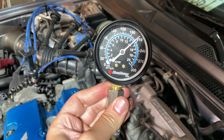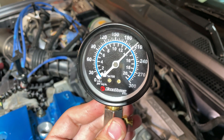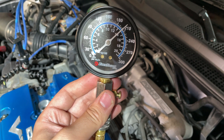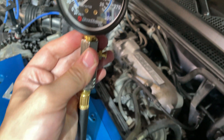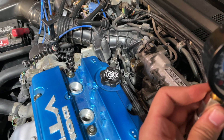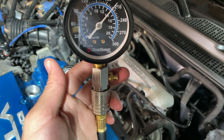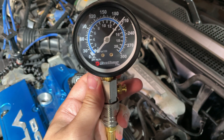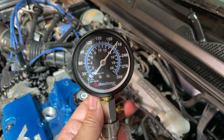So this is going to be my compression for cylinder one — as you can see it is 205 PSI, which is a pretty good number. A healthy engine is over 100 PSI, so that's really good. You're just going to do the same thing for each single cylinder and rinse and repeat. Before you take it off, push the release valve button so that you don't risk popping something or adding more pressure.